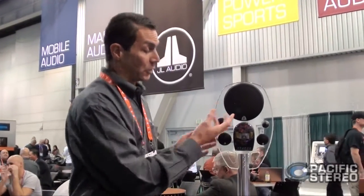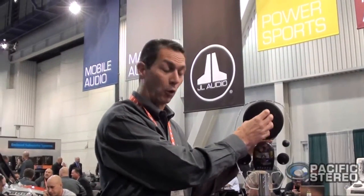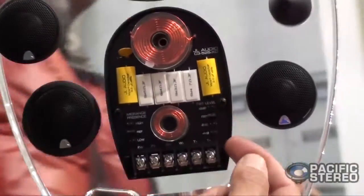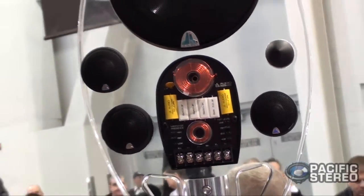Some of the features you may not be aware of on the C3 is the voicing on this product. Basically, the balance of energy between the mid-bass, the mid-range, and high-frequency is structured in such a way that these things really pop off the door — they sound really fantastic, very loud, very capable, and incredibly reliable. There's also a lot of flexibility built in around the tweeter — you have the option to mount the tweeter as a coaxial speaker, or this entire post can be attached to the center of the speaker, and both still use the same crossover. The crossover on all models, including the new 600, offers adjustments for the mid-range as well as the high-frequency driver so you can fine-tune these to your preference.